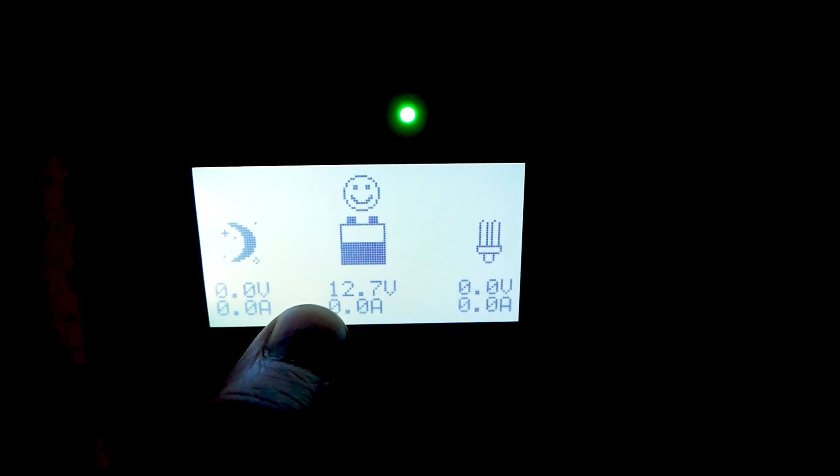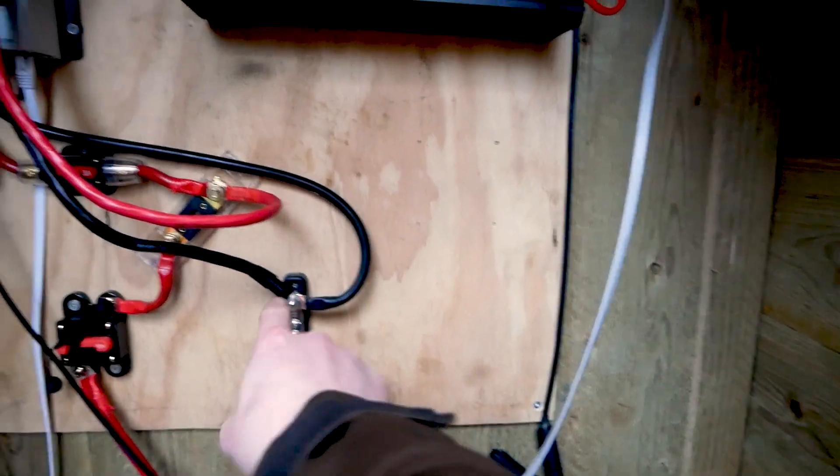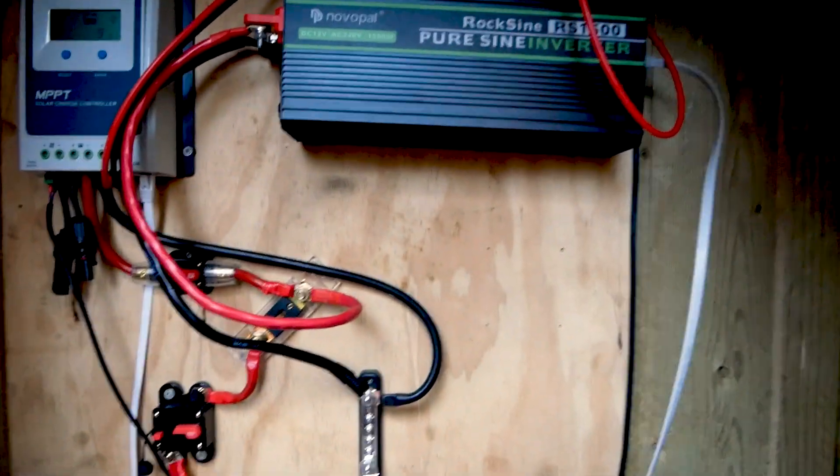Here's the charge controller and as you can see it's fully charged - 12.7 volts. Down under here is the control for the inverter, and we go ahead and turn that on now, so that means you've got on/off control of the inverter from in here. The next thing I need to do is there's a 12 volt fuse box inside there, so I'm going to create some wires so we can get all the 12 volt lights and things working. To do that we're going to take a cable from the positive here and the negative here, run it up through there inside, and then connect it to the fuse box.